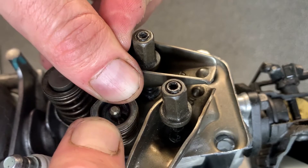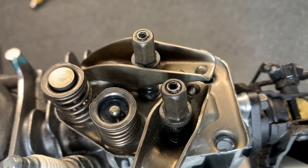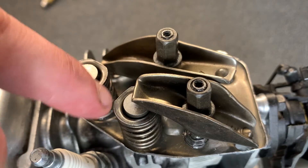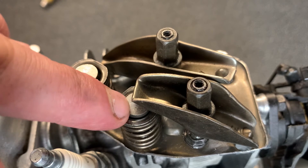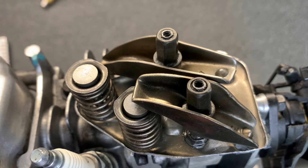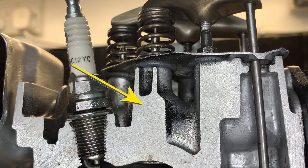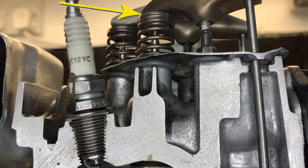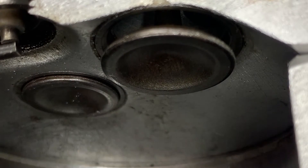The tip is hooked firmly into place on the valve, and these little metal followers sit on top so that the downward pressure from the tappet doesn't affect the top of the valve stem itself. When the valve is in its position in the cylinder head and attached to its spring, the front of the tappet pushes down on the spring and the valve stem. This pushes the valve down and opens it.